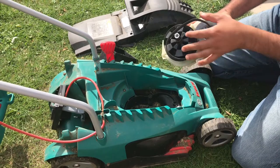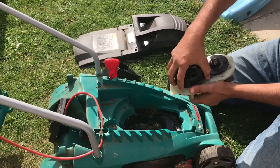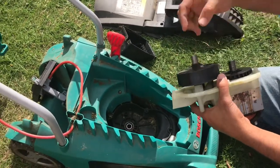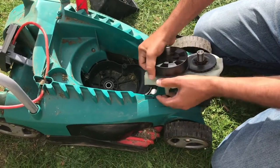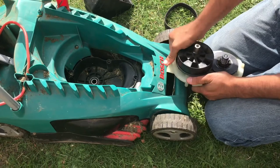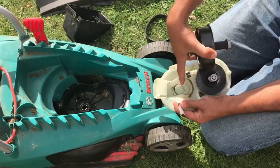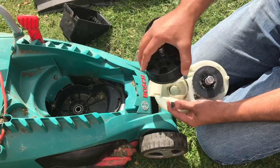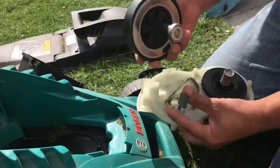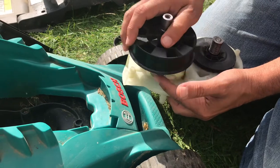What you need to do is pull the pulley off — just take it off. There is a cube inside; I'll show you: when you take the pulley off it will flip out. The pulley is just pushed in, so take it off and it's easy to put the belt on. That cube acts like brake pads to hold the pulley when you stop the lawnmower. You can put it back, and even if you can't, the lawnmower will still work without it.